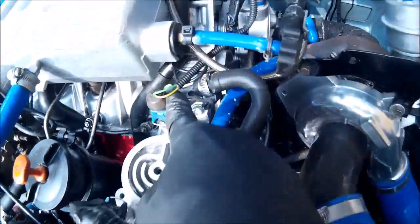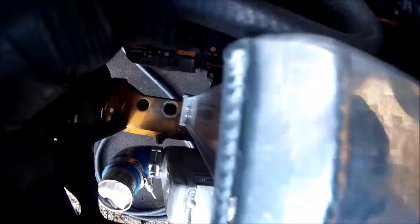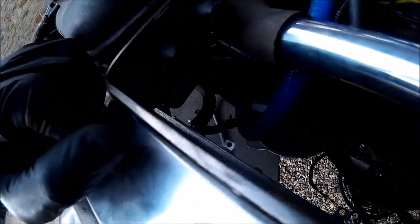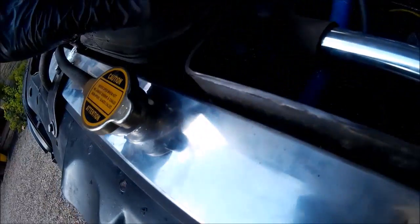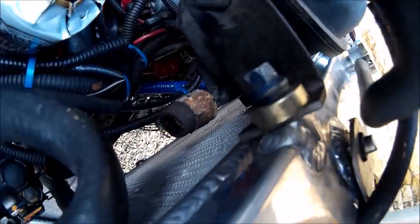The pipe from the back here is just a bleed pipe. It runs through there, comes down here — originally it went down into the rad and into the side of the expansion tank where this gap is. It now goes to the bottom of this expansion tank. I pulled over the service box diagrams to confirm where all the pipes originally went with the expansion tank across the different XUD phases — so that'll go in there, with a little joiner there at the moment that'll all be clipped in. This pipe on this side has unfortunately been cut a bit short, so we'll have to sort that — hopefully we can just put a pipe on with a Jubilee clip.